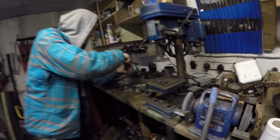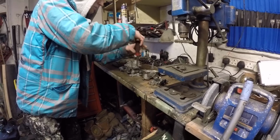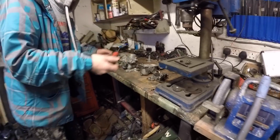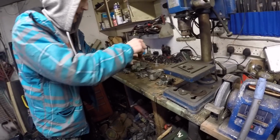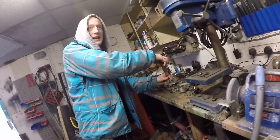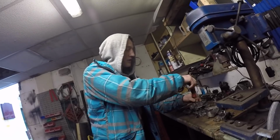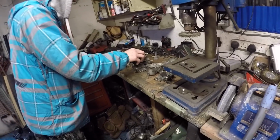We all like a bit of compound charging. It's just for that uncontrollable boost. A bit of tinkering, messing about with things. Get some stupid boost compounding, can't you? Any wasted energy, we like to save our wasted energy, don't we? That's the difference though between a supercharger. Some engines are going to vary with the performance and how they run the supercharger. But with a turbo, regardless, the air that's coming out of the engine is wasted. We don't like waste. And we want to get rid of as much lag as possible when you're running turbo.